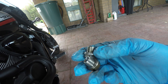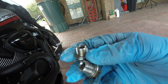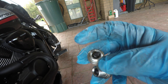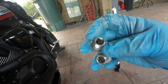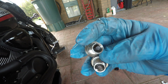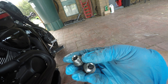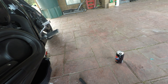These are the sump bolts. The washers on them are relatively good so I'll use them again — I don't believe in changing them all the time, though some people do and that's fine. On the end of these sump bolts there's a little magnet on each one, so any filings or metal particles will stick to the magnet instead of trying to pump through your engine. It's stopped dripping now so I'll put these back in and move the tub up to the front for doing the oil filter.